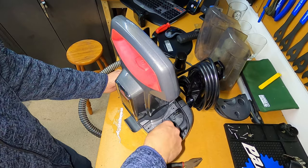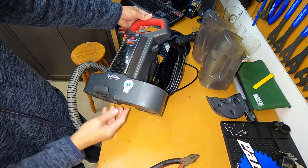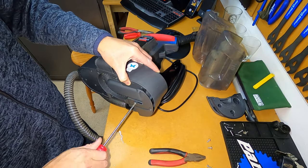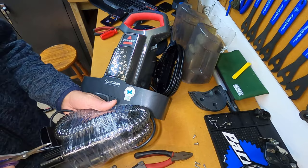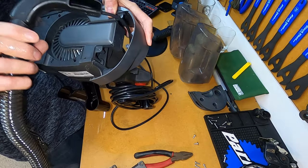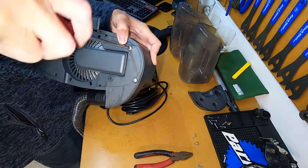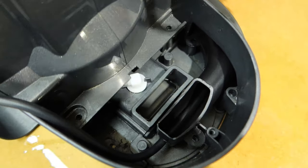Next step is just pulling the black hose through. Now to remove this hose assembly, we just need to remove some screws on the bottom of the unit — we've got three screws at the bottom, we'll just undo those. Once that cover's been removed, this hose assembly will just pull out. So our next step is to install the new hose. We'll just unpack this — you basically just want that opening there to face down when you're installing. We'll just pop this cover back on. Now we're just going to refit our screws that hold this hose assembly in place inside the unit.